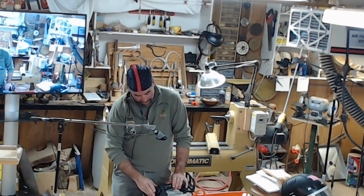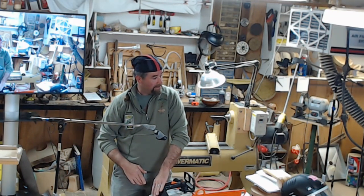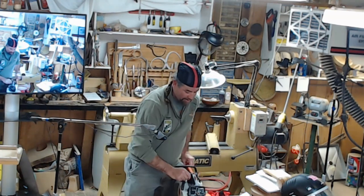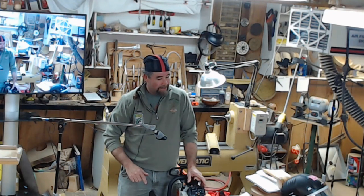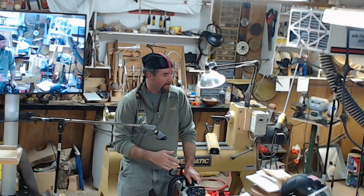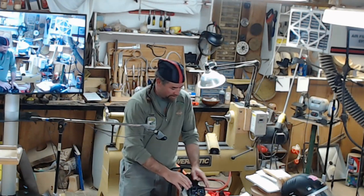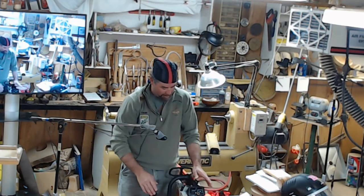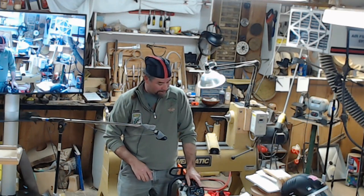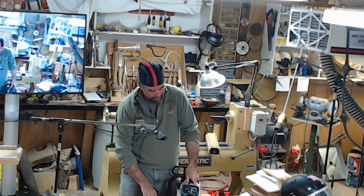And then while you're doing that on your saw, close your choke. That'll close the butterfly over your carburetor, not allow junk inside the carburetor, and you can also blow out that area. If you don't have one of these newer saws that covers all this stuff, a lot of the Husqvarnas and Stihls now have a compression system. Every five compression strokes, it actually pushes air back out. So they'll suck air, and then push, and then suck, and then push. What it's doing is blowing all that loose debris back out of the carburetor area. So I can't get to my carburetor, per se, with this thing on here. But on a lot of the older saws, even when I blow them out, I'll put my finger on the hole just in case and then blow all that out.